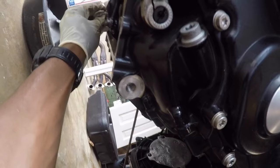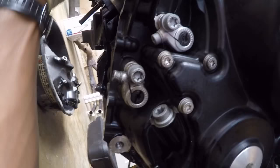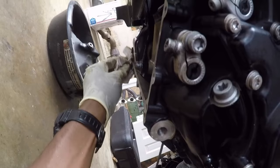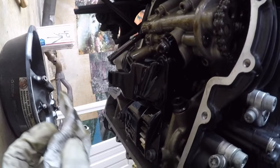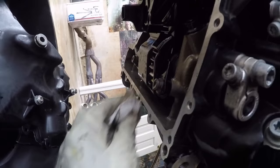I'm going to get some gasket remover, but it doesn't look like there's any gasket remaining — I might be able to just wipe it. It's so clean. BMW does a superb job with the engineering. You don't need a whole bunch of sealant on there, but you do need sealant. It doesn't have a gasket on this. While I'm in here, I can look at some of the gearing, make sure it's looking good — no marring. This is part of the transmission and everything looks good. Just oil — a little oil — that just wipes away.